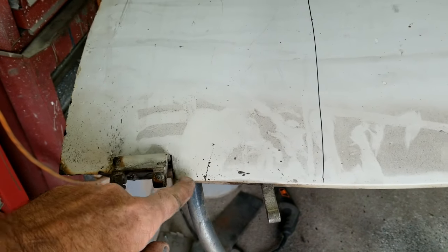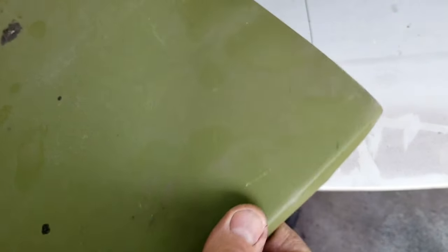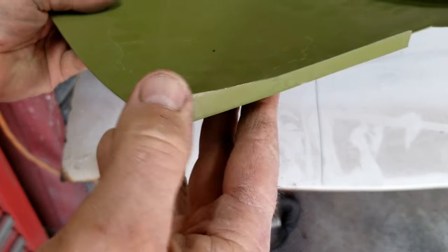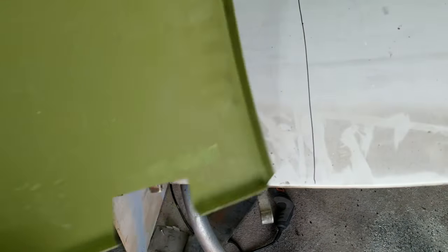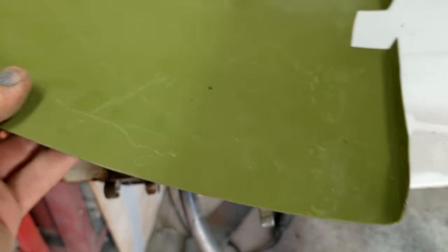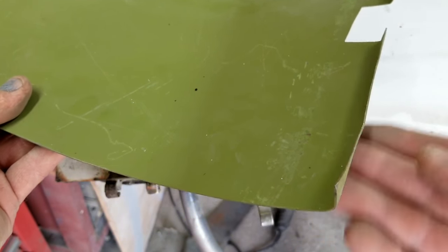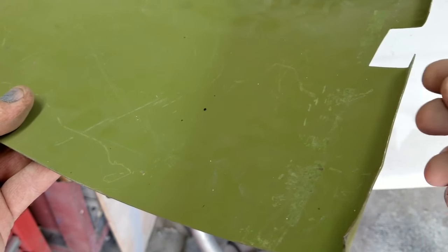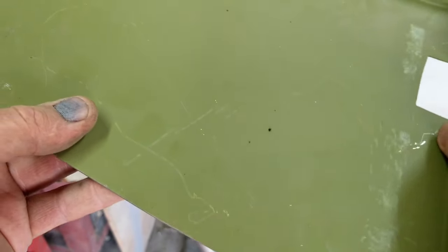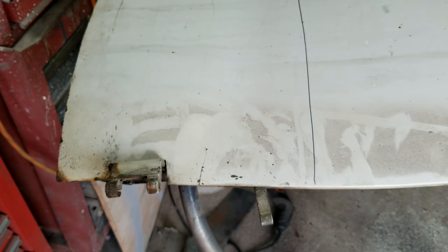I'm going to pick the grinder, go along this edge, so that this piece will overlap, if you see here, with the door skin tool or with the hammer and dolly. Either one. Or if you want to use pliers, you can even do that, and then you'll have some damaged metal to repair on the other end. But you can drill holes and weld it if you want, or you can actually use panel adhesive, or some guys even use just plain seam sealing adhesive.